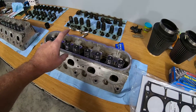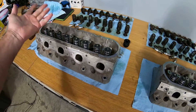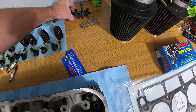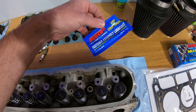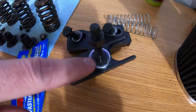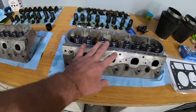All right guys, we're back. It is the next day and I knocked out the other cylinder head — I got all the springs installed and it looks beautiful. The installation worked really good. I want to give a shout out to this cheap Amazon spring compressor tool — it was like 15 bucks, I'll put a link in the description. I made sure to put some lubricant underneath the washer, used some extra washers, and it spun down really easy with my Milwaukee ratchet and made pretty quick work of the second head.